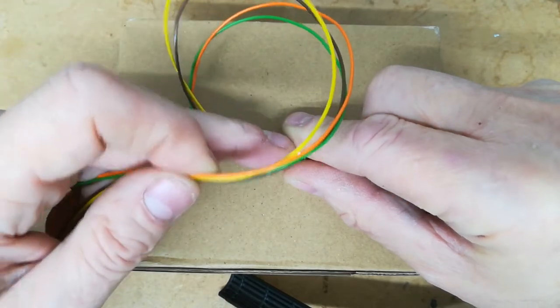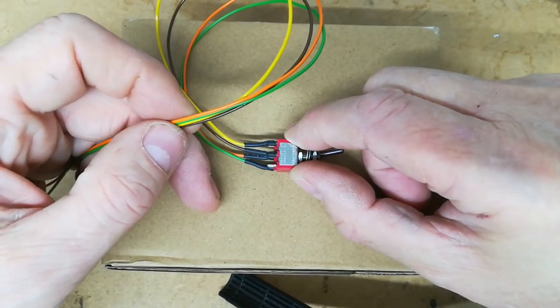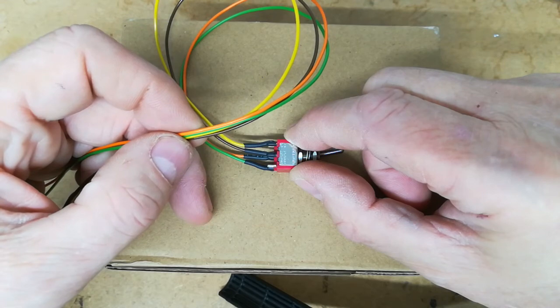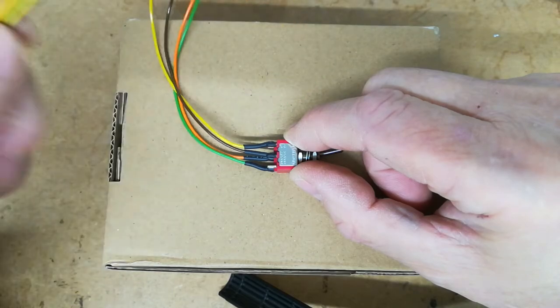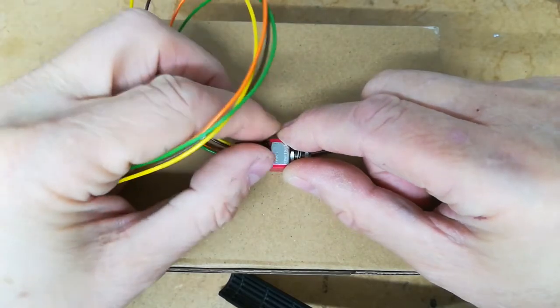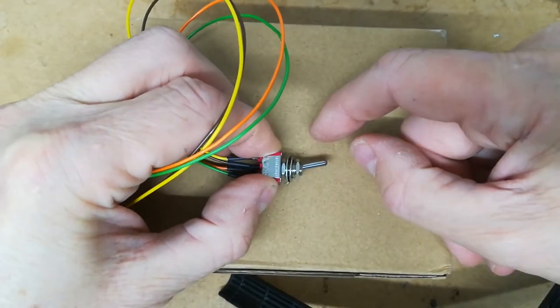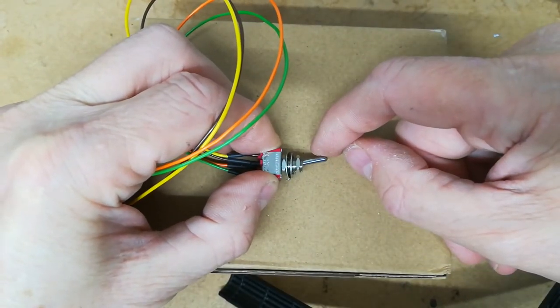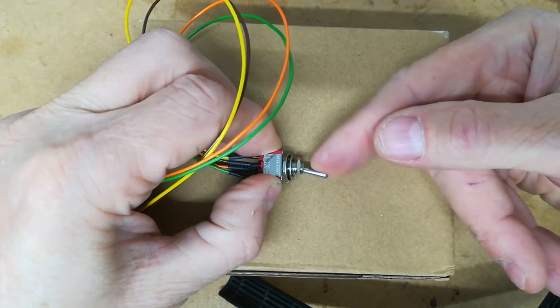I've got loads of Insight connectors. I'll have a look at the clutch connectors and see if I've got anything suitable. If I have, I might try and make myself a couple of pass-through adapters so I can just unplug the switches and plug them into a pass-through device which has this wired in parallel. So hopefully you understand that. This is to increase regen and potentially to disable assist and regen by faking the clutch pedal, and increase regen by faking the brake pedal.